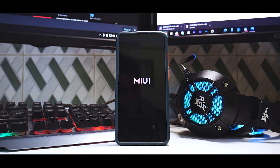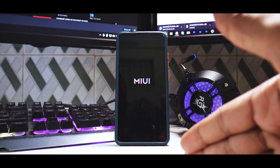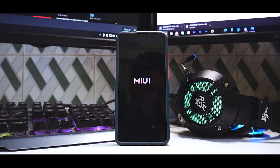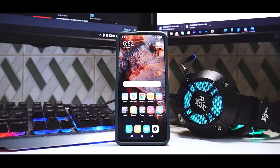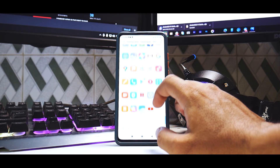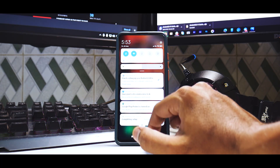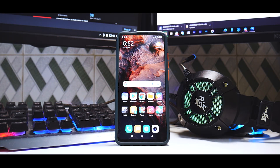From MIUI 12 we'll go to China Stable, which is similar to China Beta 12.5. The process is always the same: before flashing every ROM, format data, reboot recovery, wipe everything including internal storage, use a pen drive and OTG cable, flash the ROM, and you should be good to go. Let's wait for MIUI to boot up. As you can see, we've just booted into MIUI 12.0.5 — it's a very clean flash. Now we are going to go to China Stable.